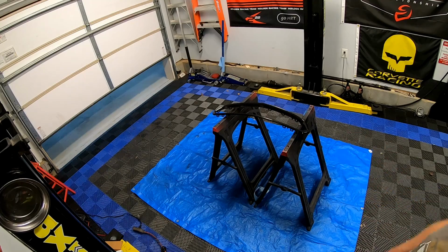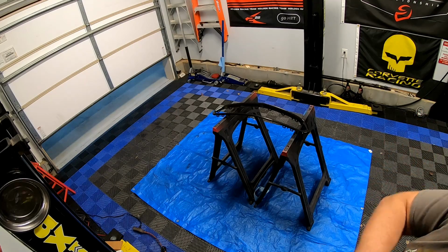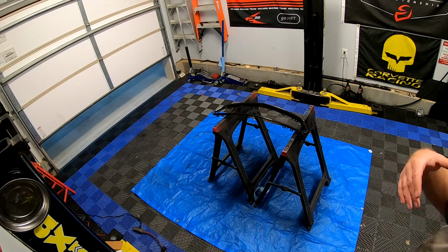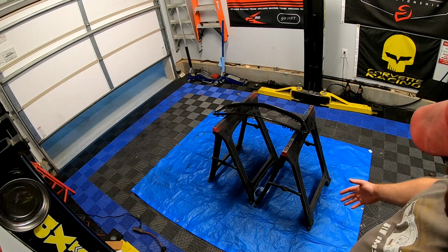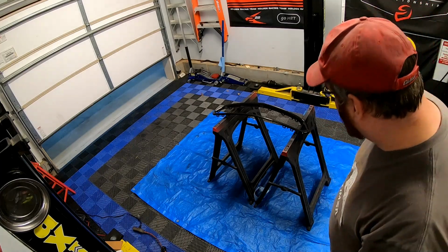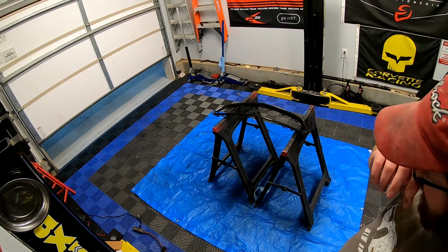but I didn't have enough for a second coat, so it was like either do one heavy coat or do one full coat and then deal with dry spray halfway through your second coat. So I didn't want that to happen. So we'll have to deal with the run, but I'm not too concerned about it. There should be enough clear coat on here, like I said, so that we can polish that out.